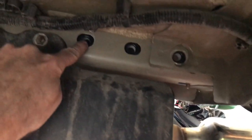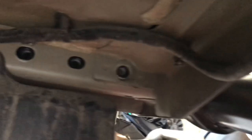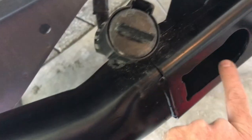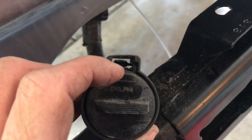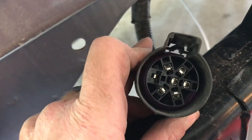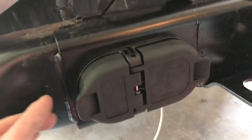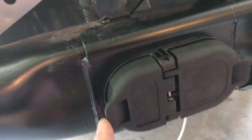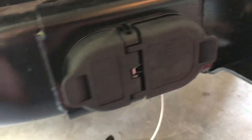Now we're back under — we're going to need one bolt, two, three, and the fourth goes under there. We'll get those in and do the same on the other side. Before you feed the factory installed wiring harness through, you want to take off this dust cap — just stick a screwdriver in there to prise up that little clip and it comes off. You'll see the socket is nice and clean. Now we just plug it through and into there — the seven pin and four pin just slides in, clips in, and we check it on the back to make sure it's all plugged in.